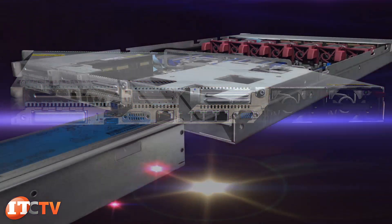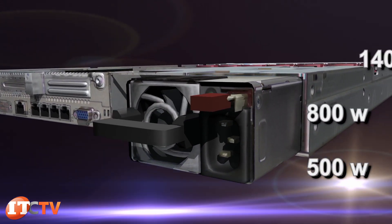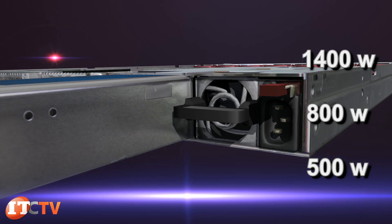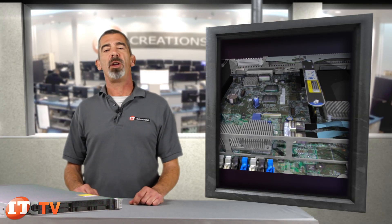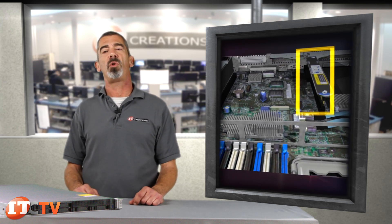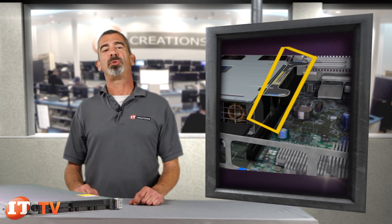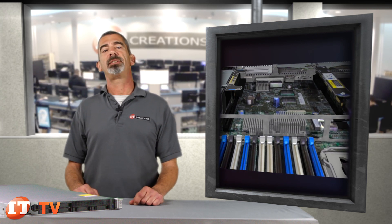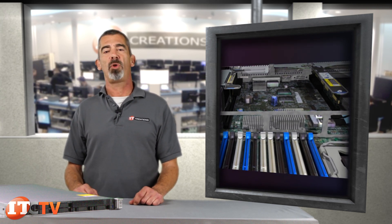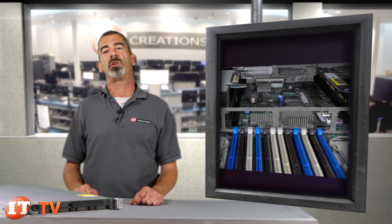There are three different output options for platinum-rated power supplies: either a 500W, 800W, or 1400W flex slot hot-plug power supply that can be used across a variety of HP ProLiant Gen9 servers. A primary PCIe riser offers two PCIe Gen 3 slots of X16 full-high three-quarter length and an X8 low-profile slot. One of two optional secondary riser cards can be installed in the two-processor configuration to add an additional X16 PCIe Gen 3 slot low profile, or bring the total usable slots to two X16 full-high three-quarter length slots.